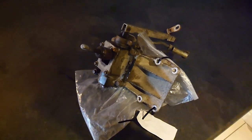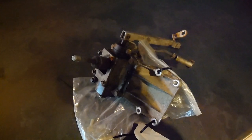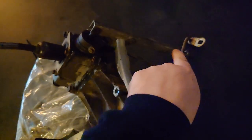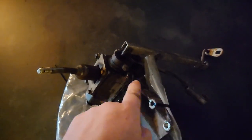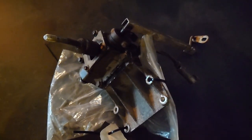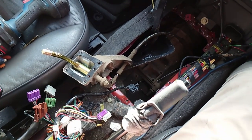Now we need to see what else we've got to dig into. This is the part we're fitting today — the transfer mechanism of a 300 TDI Discovery automatic. It's essentially the same as what's on the TD5 apart from this part here, which will operate the center differential. On the TD5 it's cable operated, but it's going into the same transfer case.